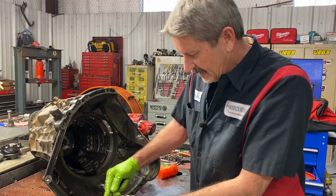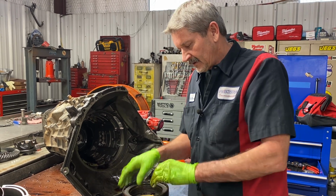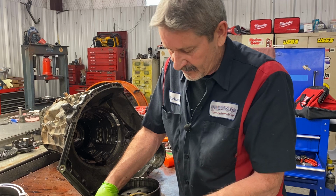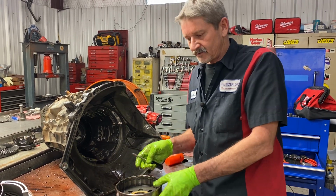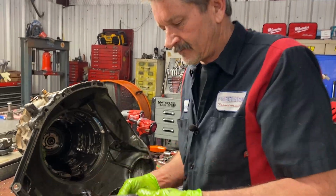So, you know, if we ever have to do anything, it's usually adjustments inside the vehicle, or basically in the valve body, or if I go driving and I don't like the way a gear works or something like that, then I can go in there and change it. So we never want to pull the unit out, period.